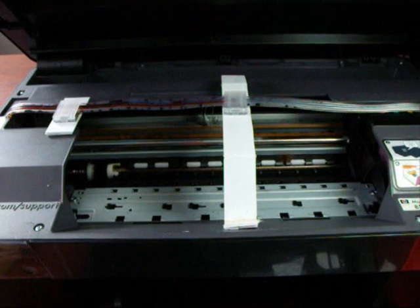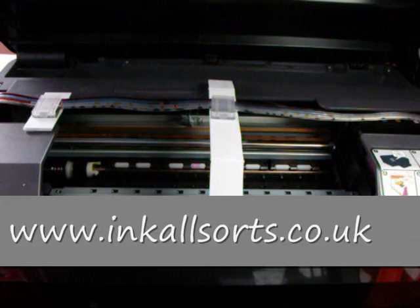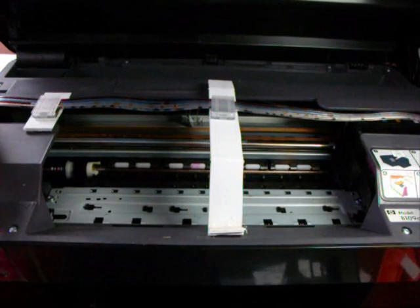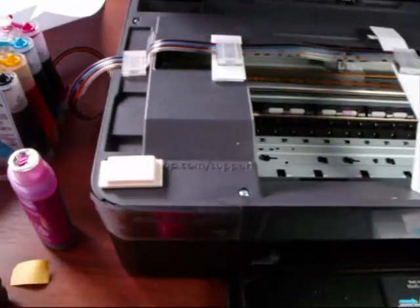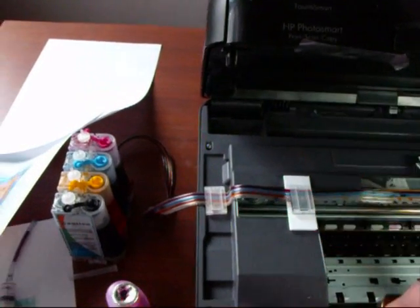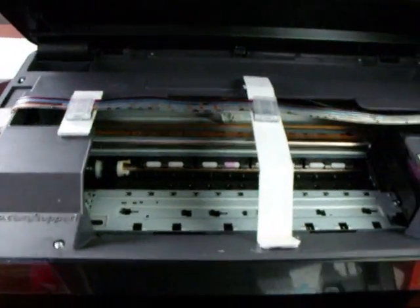So if you're all up and ready to print, let's see what happens. Just one more thing to do because I've just been running some tests while the video was off, and it was very sensitive to the lid being right down because this clip at the left doesn't hold it totally. So what we're going to do is make sure you've got one of these — a similar clip that just sticks on there. There's a hole there for it, but if we put something over it like that, nice and stiff, it stops the printer lid shutting right down and there are no problems.